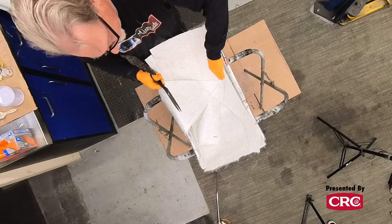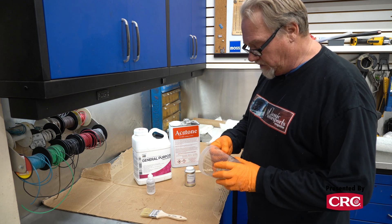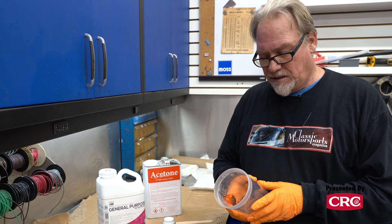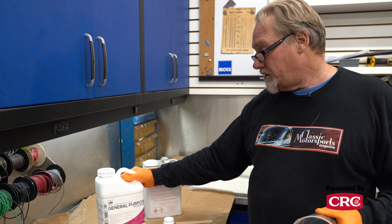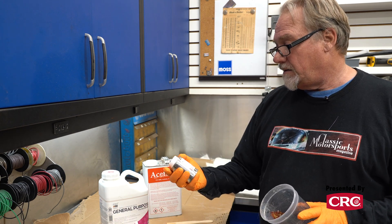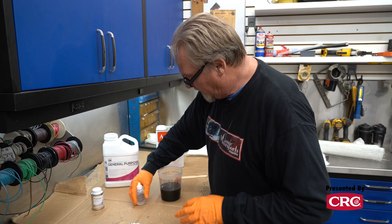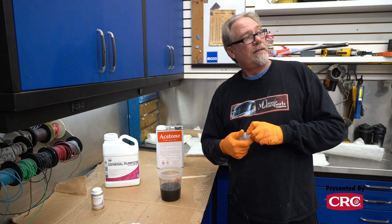So we've got our pieces roughed out. Next, we've got to mix up some resin. You mix this up in small batches — generally about 4 to 6 ounce increments for small repairs. This is a big job, so we'll go up to about 16 ounces. This is a general purpose polyester resin and a hardener. And this is a little sanding aid which has got a little wax in it, which will make this release a little easier. So we've got about 12 ounces — you need about 10 drops per ounce.